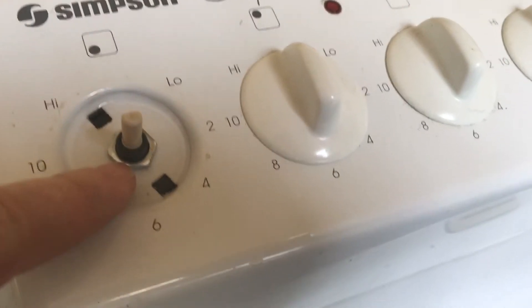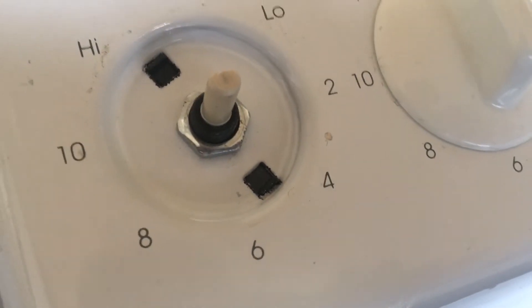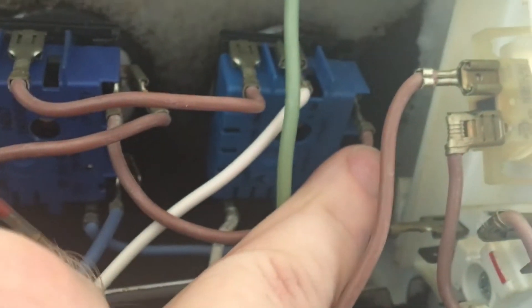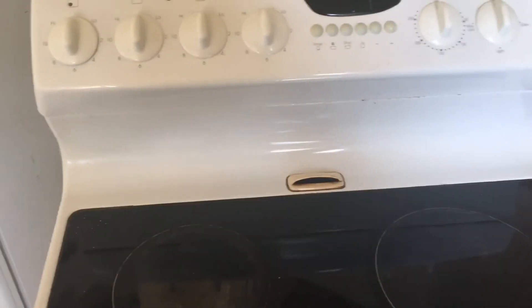I've already remounted the new one in there — that's with the knob pulled off. The knob pushes onto the shaft with a little gripper, you just pull it off easy. I've got it mounted back in and done most of it. There's one wire here to put back on. That's all the connections back on again. Three wires to the load connection, the pilot light, and coming from here to there — that's the phase, which also runs down the white wire. Neutral's in the bottom corner.